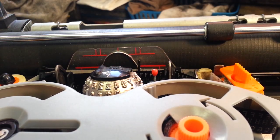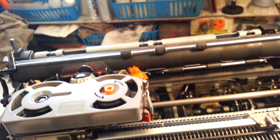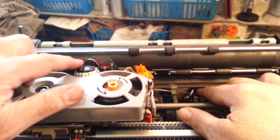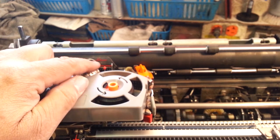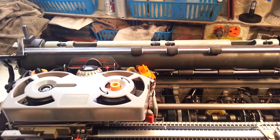So that's what happens when you get a misprint action. Make sure the pulleys are clean in here. Run the cables, run all the tilt and rotate. Make sure the ball's clean. Make sure the ball's good. And then adjust the underneath at the rotate adjustment.